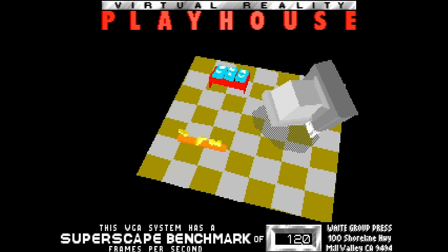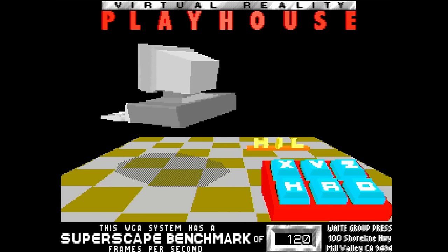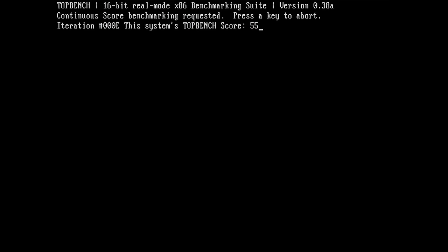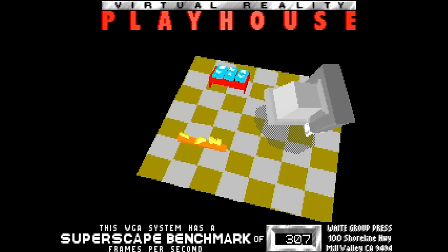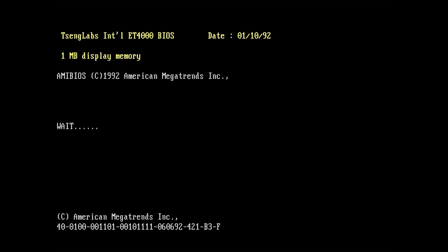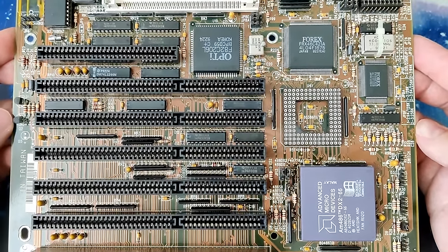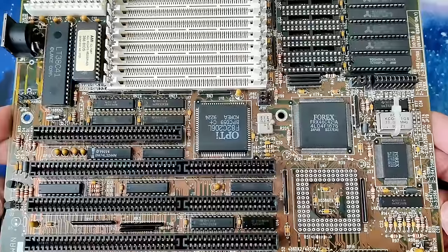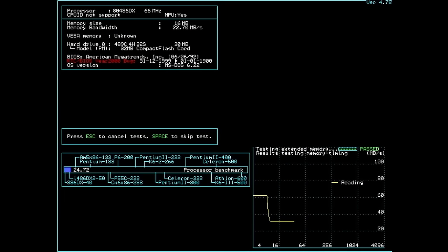Of course, I re-ran the other benchmarks, and I was quite surprised when I got different results — the system felt faster. TopBench increased from 55 to 76 points, and the access time in cache check reduced from 78 to 40 microseconds. What is going on? I tried to figure out what happened, but I could not reproduce the lower scores from the initial benchmark runs. The only way to get them back was to reboot the system. I didn't want to spend much more time on this problem — maybe it's an issue with the turbo feature implementation. So I continued to gather benchmark results with the turbo feature switched on for the system's best performance.